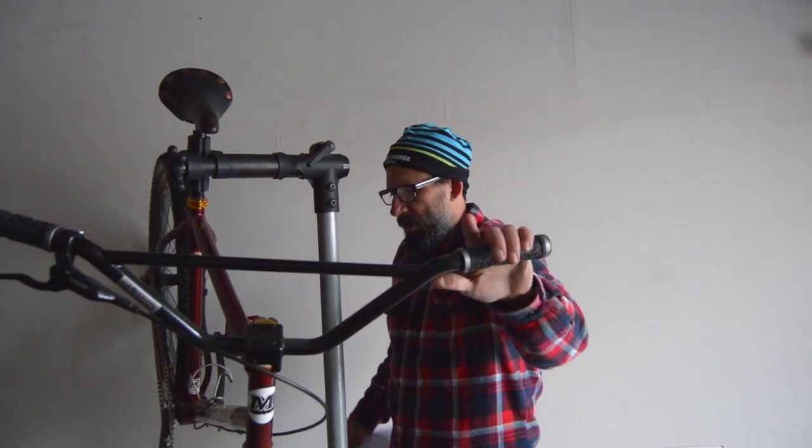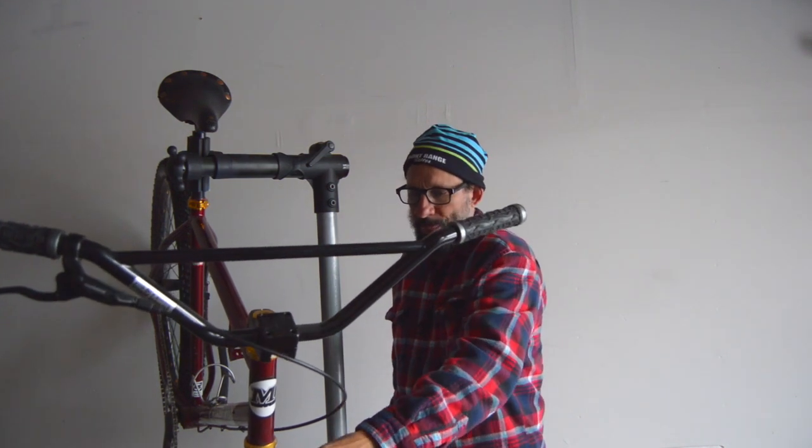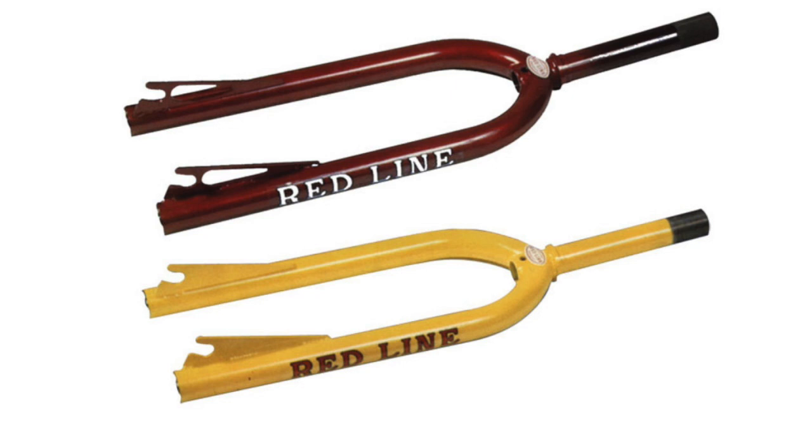The overall frame and fork concept was basically designed to be a copy of my 1975 Webco that had Redline forks, kind of like this one. It's an oversized version of that same bike, kind of as a clunker. The basic plan was to build a fork that was oversized, that would fit a bigger 27.5 or 650b wheel, and basically looked like an old 20 inch BMX first generation Redline fork.